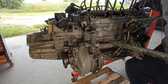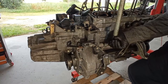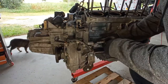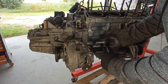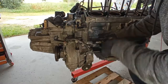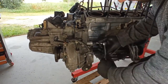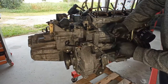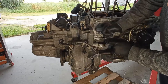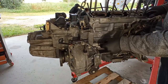And this goes on for a bit. Almost 90% of the bolt was like this. And I was dancing here with the bolt left and right, left and right, to keep the threading in one piece. And eventually, 2 threads before the screw ended, I could take out the bolt by hand. But this pretty much dictated the condition of all the screws of this gearbox.